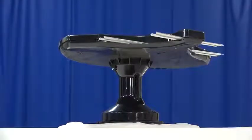When using the roof-mounted antenna to receive your TV signal, make sure the antenna booster is turned on. The booster is located on one of your cable outlets inside the coach. You will see a green light on the booster when it is powered up. When you are viewing the signal through cable, you'll need to turn the booster off to get a clear picture.